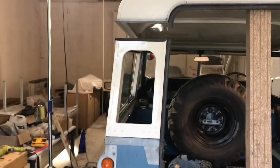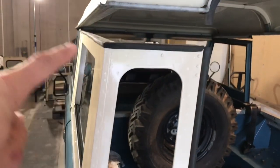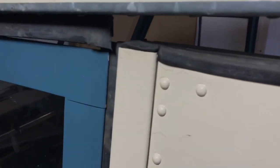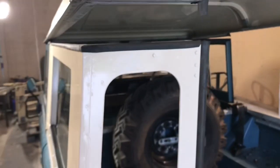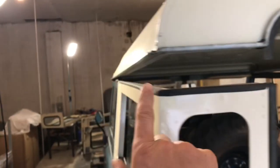On the other side, it stayed in when I took the glass out, so I'll just paint it. Otherwise, putting all these seals in - I've taken them off the panels I had before. There's quite a few seals, actually: the top one, the main one, the bottom one, the side one, and two small corner seals up here and down here. From the factory these are all stuck in, but I haven't got the right glue. On the basis that once it's fixed it's never going to part from there anyway, I'll just lay them in - it'll be fine. The glue doesn't act as a sealant, it's just sort of dabbed on at a few points from the factory and is actually quite easy to remove.